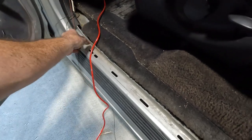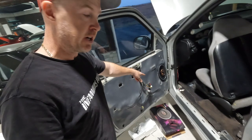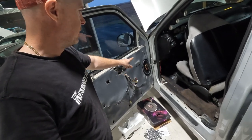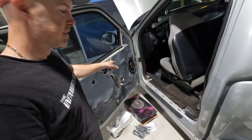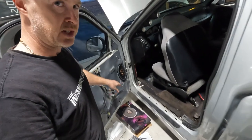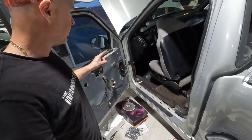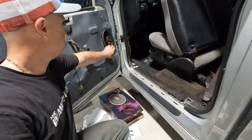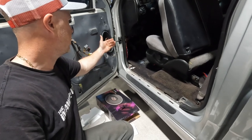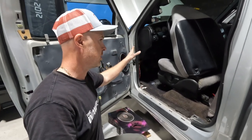I'm going to cut out the old remote wire, run the new remote wire down with the power wire, and get it back to the rear. Got the 6x9s installed. For anyone curious, the factory size is in fact a 5x7, but you can make a 6x9 work — you just have to roll the edges of the door a little bit. If you don't want any modifications, stick with 5x7s. Also note: these tweeters are on a slight angle, so I made sure they're facing toward the individual and not straight forward into the dash.